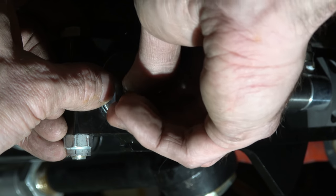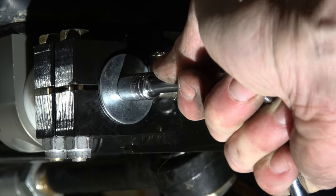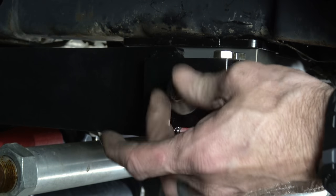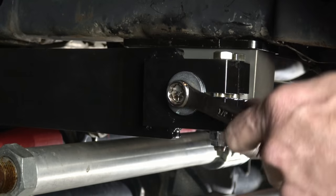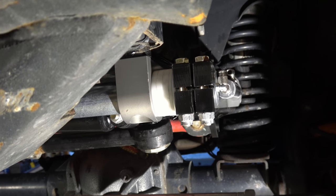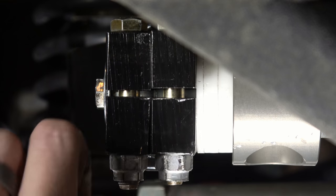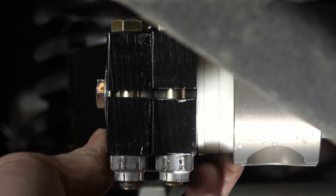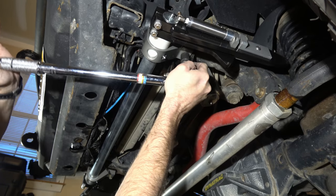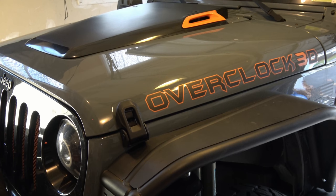Now on the latching arm side, you're going to have a Zerk fitting. You're going to use the thinner flat washer, the fender washer, and then install that Zerk. That Zerk is why we needed the hole on the inner smaller diameter torsion bar. On the other side, we're just going to use this bolt and the washer as a cosmetic cover for that little hole — a Zerk only on one side, the side with the latching arm. Here's a look at the spacers — you want it to be snug but not overly tight. Then I'm going to torque down the other two bolts for the frame mounts.